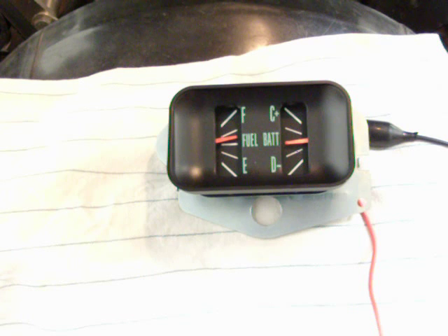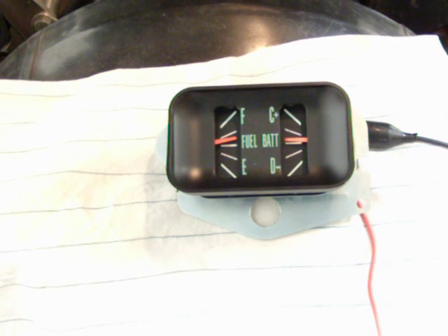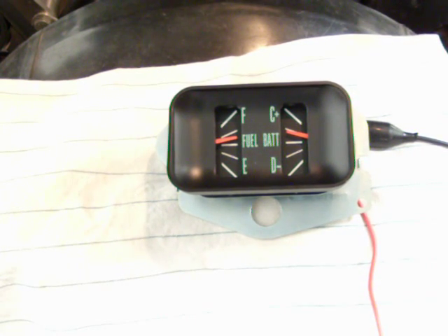Now the car is off and the needle is in the middle. I'm going to start the car again to show you how that looks. Again, you can see it's charging the battery because starting the car takes power. That power is not sensed by the ammeter as it leaves the battery, because it goes directly through that huge positive wire that goes through the starter. All other power goes through the other wire that comes across the front of your car.